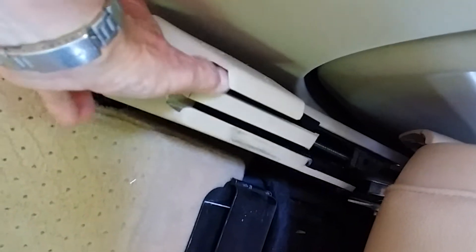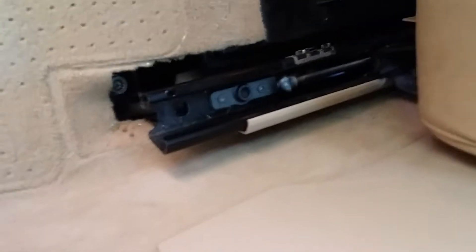This video is about how to replace the batteries on a 2006 VW TDI. I've seen other videos and they're good, but none of them mention that before you start — you see this panel here on the backseat — you need to remove these two panels on the left and the right, since you're going to be swinging the seat back.